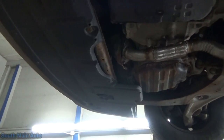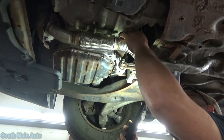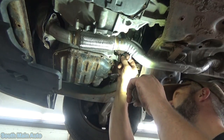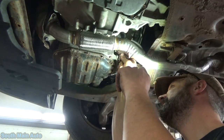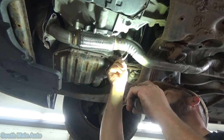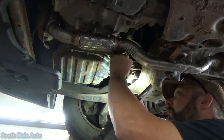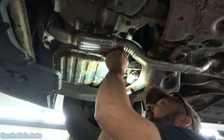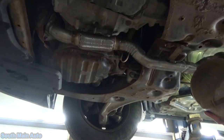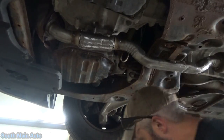Let me plug in this front O2 sensor - that plugged in right over here. Well, that sucker sits close to the drive shaft - I want a zip tie. It was probably attached to this metal bracket from the factory - it looks like it was. So we're going to have to throw a zip tie on that because it sits like a half inch away from the drive axle. Same in the back - there's a metal tab where it looks like it used to go.